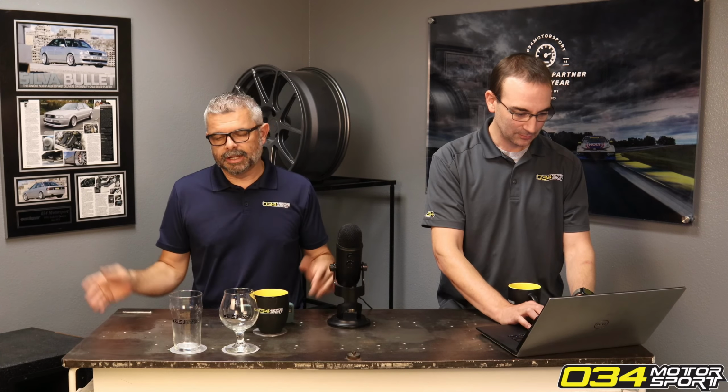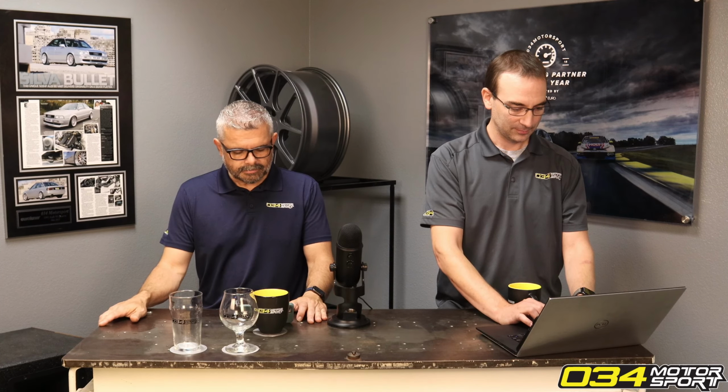We talk about this a lot on here. There's a lot of 3.0T B8, B8.5 type of engine problems that are the result of the age of these cars, some Achilles heel issues, intercoolers leaking. We've talked about a customer who misinstalled their high pressure fuel pump and filled their crankcase with gasoline, and ended up spinning some bearings. Misinstalled pulleys, and there's been some cases of pistons cracking in half, but with no evidence of detonation. So, anyways, engines fail, and when you take them from 330 horsepower to 550, stuff's going to happen every once in a while. Now, these cars are overall extremely reliable.